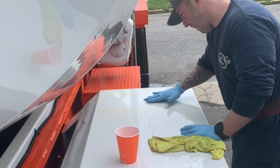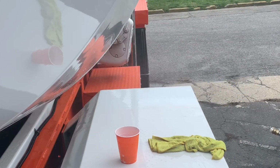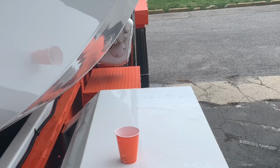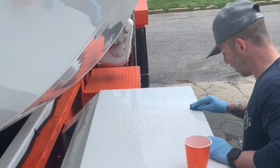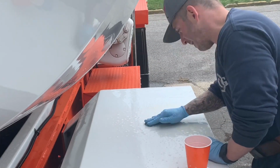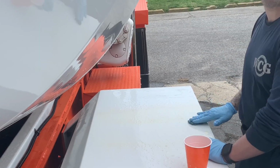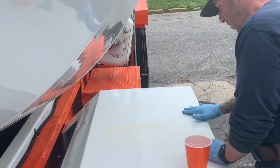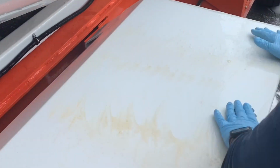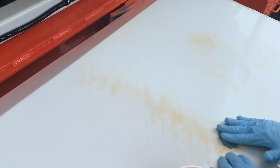So what I'm doing here is removing orange overspray that got on these white fenders, and it's pretty self-explanatory. I use clay. It's a medium grade clay. I'll put the link in the description to Amazon. And I went through basically one full bar for both of these fenders. Washed them. I applied some Liquid X from a rag, and then I would take some of the Chemex degreaser and put that on there, a couple squirts, and I would rub it out. You can see all the orange on there. So I'm gonna let you guys watch this part.